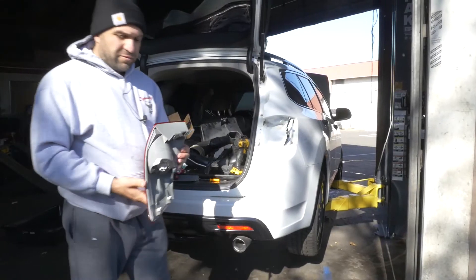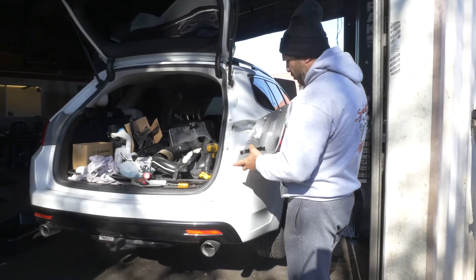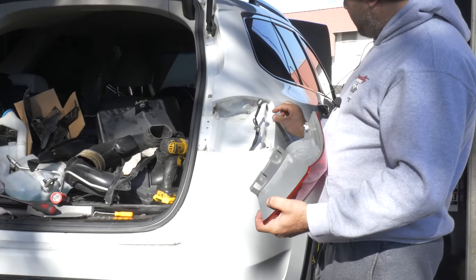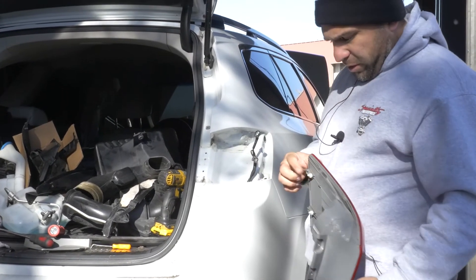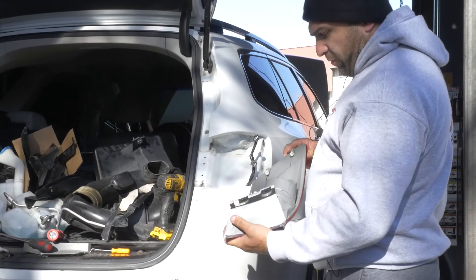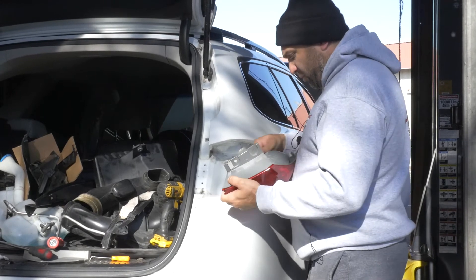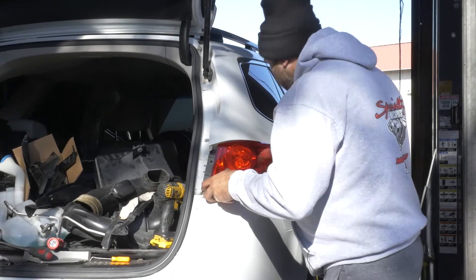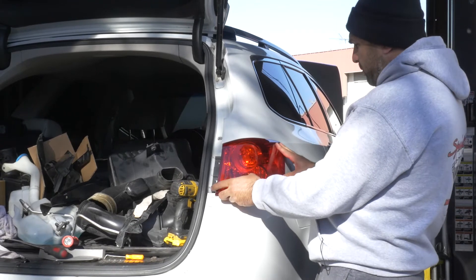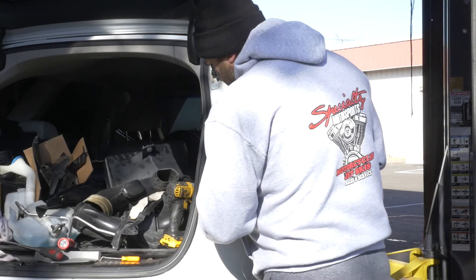Now I've cleaned the taillight and this whole area, and I'm going to put it back in. Most cars have these tabs that are slideable and protrude so you slide them in, but on this car it's the other way around — you've got these two clips here that pop in this way. First things first, plug these guys back in. They only clip in one way, so make sure they're plugged in all the way. Then you can see from here you can line up these little tabs — the little nipples that are right here — they go right into it.